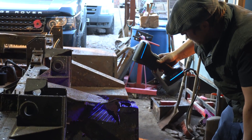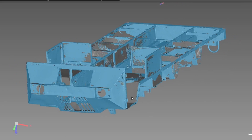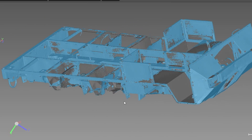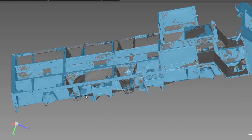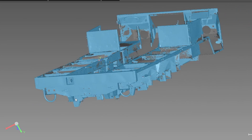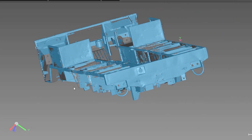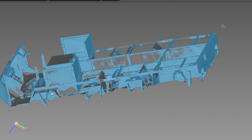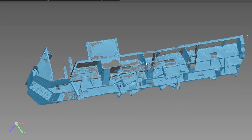The end result of all that arm waving and laser firing is an incredibly accurate 3D model of the entire Isako chassis and superstructure. With this we have a digital record of the exact shape and dimensions of the Isako, and a very easy way of designing and cutting repair sections and panels to fit perfectly. 21st century technology is coming to the rescue of a very 20th century vehicle - I bet old Michael Somerton Rayner never imagined this when he was welding together this prototype in the early 80s.